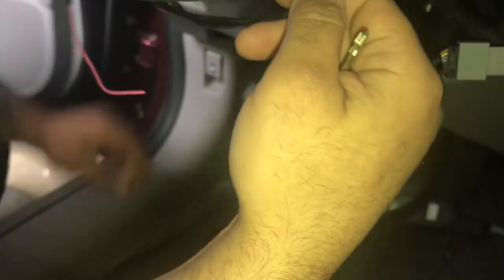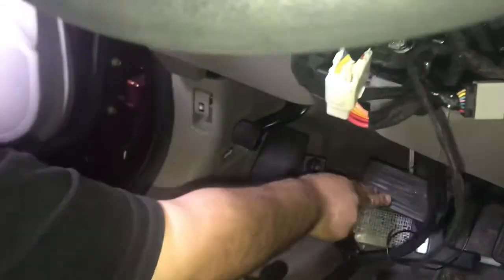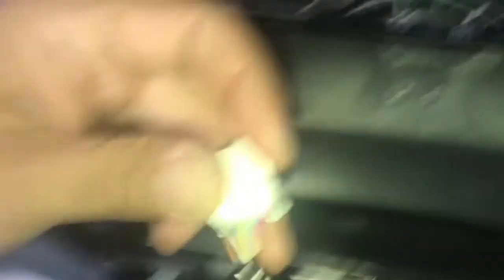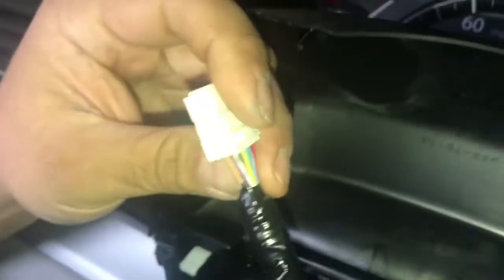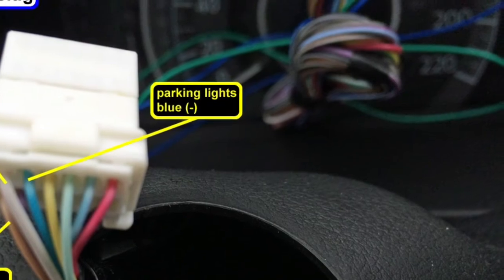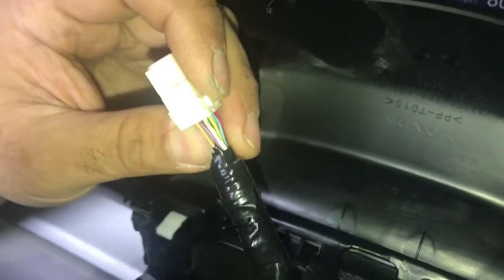The only last connection is the parking lights. If you have auto lights, you don't even need this connection. But to access the parking light plug, it's the darker blue wire — it also shows you on your diagram that comes with the directions. Make a connection there for your parking lights.